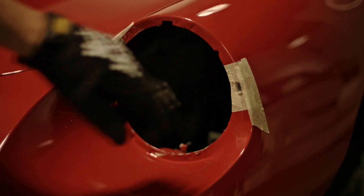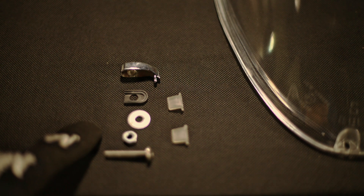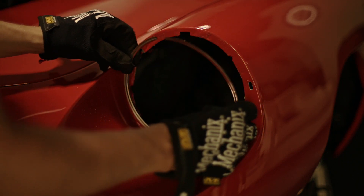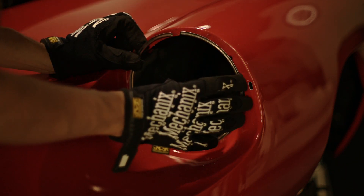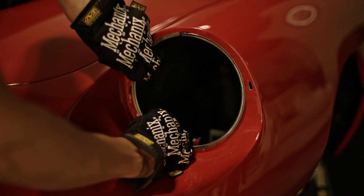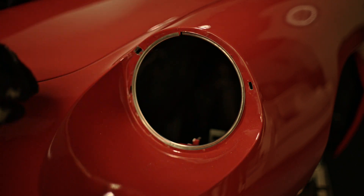Make sure that these small pieces fit perfectly — they are very important for our conversion. You will find in the description a link from Classic Alfa where you can buy these headlight cover plastic parts and the headlight cover fitting. Now after all the holes are done, we are installing this special ring, which will help us to hide all the bad corners, because now we are installing the headlight from the back position, whereas in the original version it was from the front.